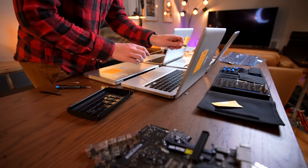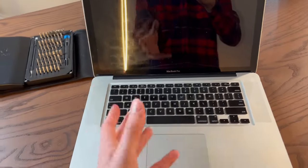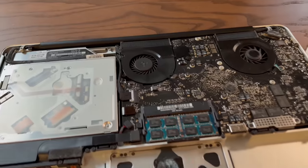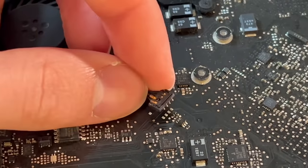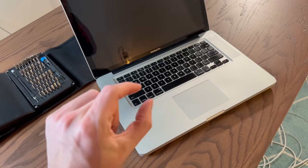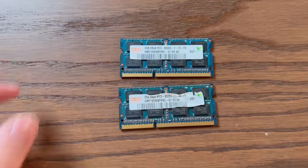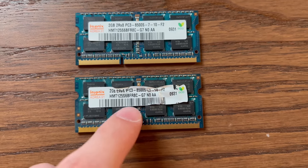In the process of testing one particular MacBook Pro, we had a slight issue. I discovered that one of the fans on the logic board had a broken connection that snapped off, so it was only running on one fan. The reason I figured that out was because there was a small fire. The lower RAM stick is melted because of how hot it got in there, and it smelled like smoke.